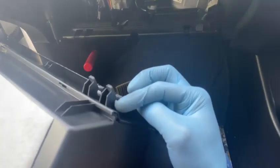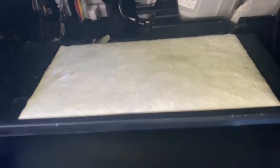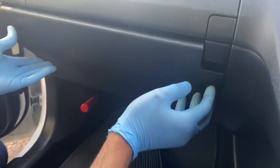To put the glove box back on, make sure these corners and edges hold on both sides. This is the location of your hydraulic strut. Put the USB cables inside here, then put these corners up and fit them in. Then come back to this side and click the hydraulic strut back on. Once it's clicked, you just need to push slightly inside and that's it — job's done.